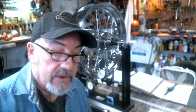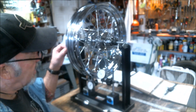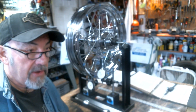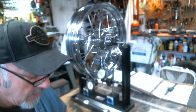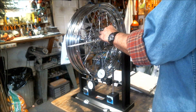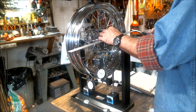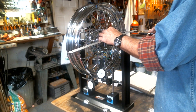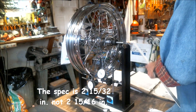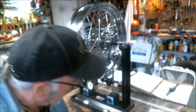Today I'm lacing and truing the back wheel on my '73 FX. I've got the lateral and the radial runout in spec at a 32nd of an inch and I have the wheel centered. The spec is two and fifteen-sixteenths of an inch. Now I need to set the torque on the spokes.